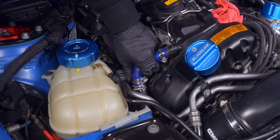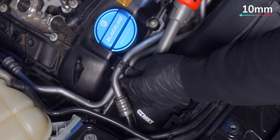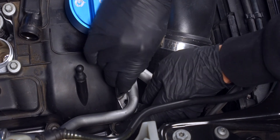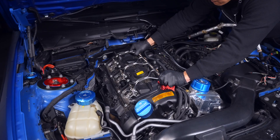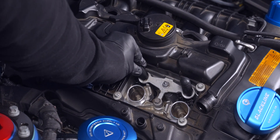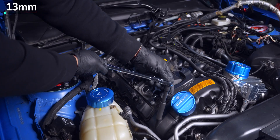If you still have your OEM breather hose, pull on it while lifting up on the tabs with a pick starting from the bottom — hopefully you still have all four. For the front oil lines, remove the 10mm, then the support guides, the T25, and the mounting bracket, which will also reveal bolt number 25. Remove the fuel lines carefully so no threads are caught, tilting them toward the towel to prevent dripping, then immediately cover the exposed openings. Fingertips of gloves will also work as covers — you want these covered to prevent dirt from ruining your high-pressure fuel system.